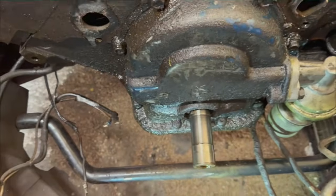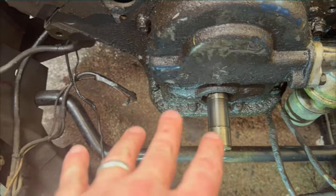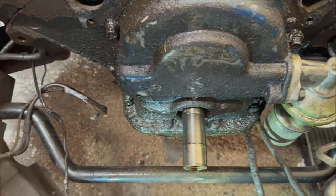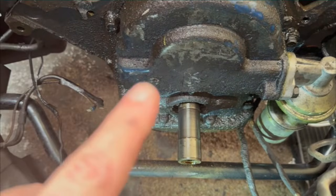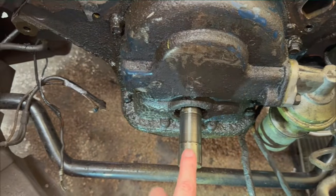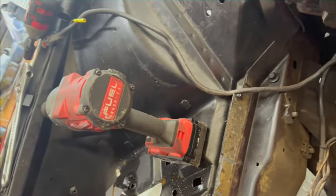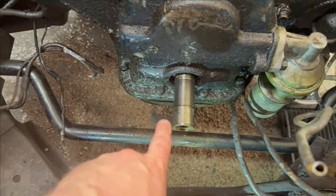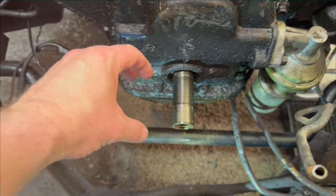Yeah, just something I did while my battery was dead. I pulled this crankshaft damper and the pulley off, and the crankshaft sleeve. I didn't video that, but it was pretty simple. You have a big nut here, which I broke loose with that guy. I think it was a 15/16. No, it was. And it had three bolts, and the front pulley comes off.